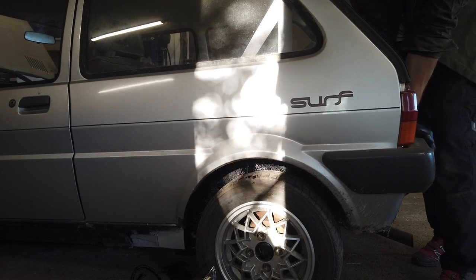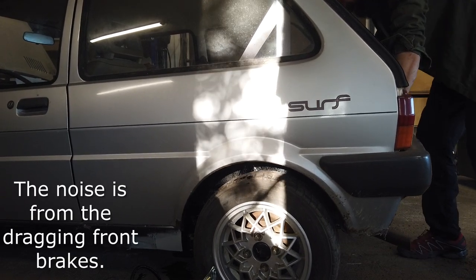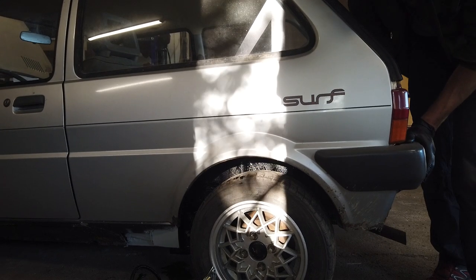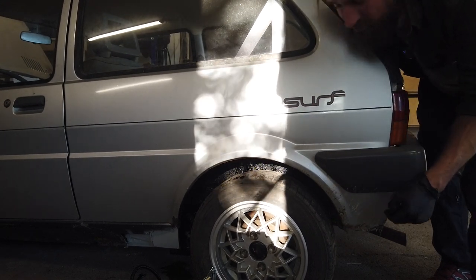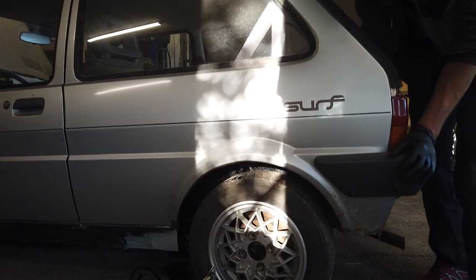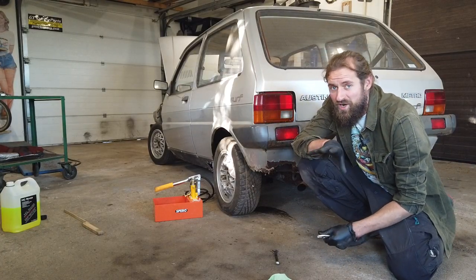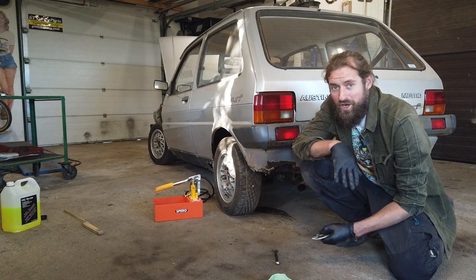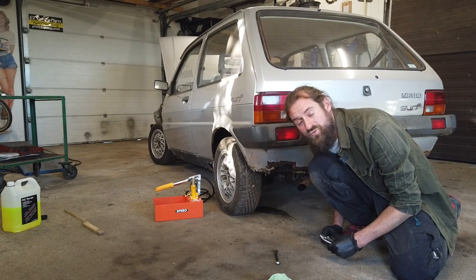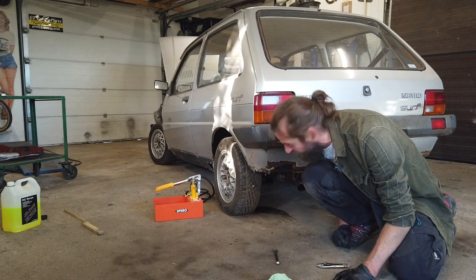Let's see if there's any suspension. That seems really nice actually. This is not a rock hard suspension, that's for sure. The nitrogen in these units seems to be just fine. I wouldn't want it to be softer than this, and it settles just like that — wow. So that's it. This is my first time trying to mess with the hydro gas suspension and pumping it up. As you can see I had a little leak here — I didn't tighten up that connection enough. I did that now and it's not leaking anymore. I was really scared of doing the same as I did on the other one and shearing it off, but it held up. So it just seems to work.